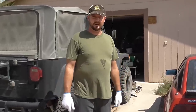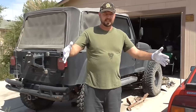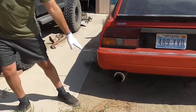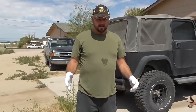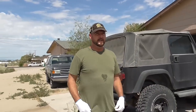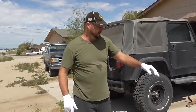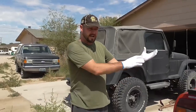This is a 1986 300ZX Turbo — an example of an exhaust I've done a free-flow upgrade on. I went to a reputable muffler shop and let them know what to do. I looked under the car: from the factory it had a really big, large, heavy cat, which was replaced with a nice free-flowing one like a Magnaflow, and nice big exhaust tubing was done all the way to the muffler at the tip. This is more of an economy exhaust because that muffler was only about $20 at AutoZone — you can buy these little 3A mufflers, they're really cheap, very light, you can look right through them, they're free-flow, and yet not obnoxiously loud. An exhaust shop with a tube bender can probably do it for about $100, so maybe for $120 to $130 you have a nice free-flowing cat-back exhaust.